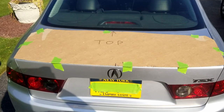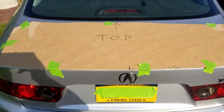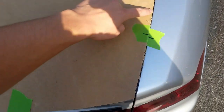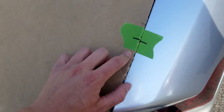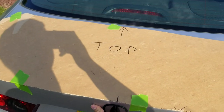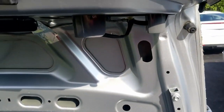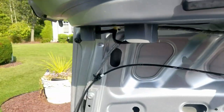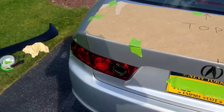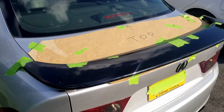As I said earlier, I'm not going to use the mounting points that are on the spoiler because I've got to retrofit it. So I put a piece of cardboard down to help me — I cut it where the trunk lines are and made some reference points so I can lift up the trunk and see where I'm going to want to drill the holes for the spoiler to come through. Later I'll take those points and put them on the wing so I'll know how to mount it. The wing is centered on top of the cardboard.